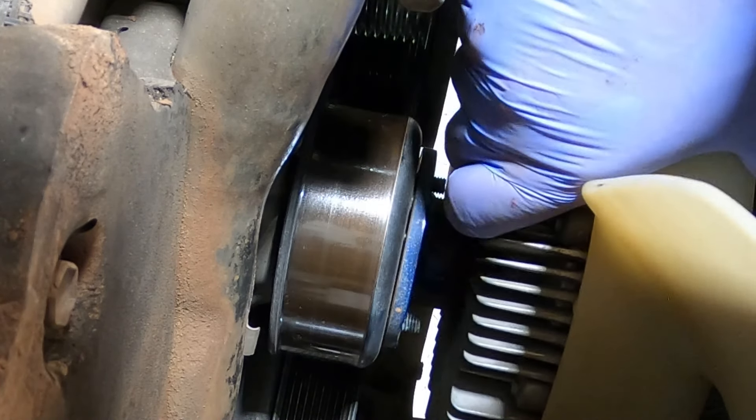Now pop the pulley back on, orient it so the marks line up, and then the fan goes on. Pop the four nuts on and tighten them up. It's time now to put the snake belt back on. I've pulled one out of my spares box — on the back of it I've glued the route that the belt takes, so I'll use that as my guide. Part number 99369-K2250 if you're looking for a new belt.